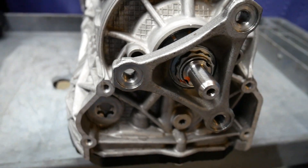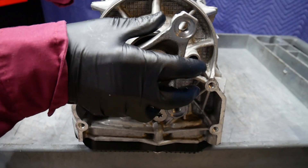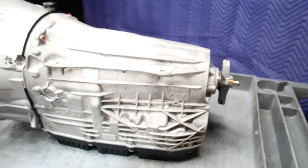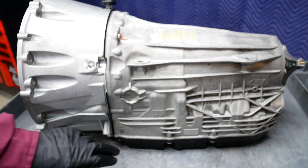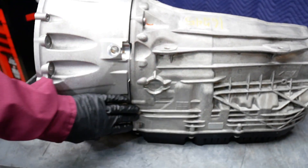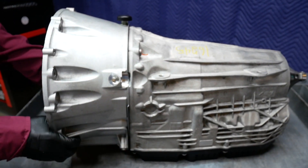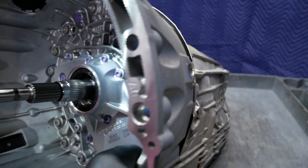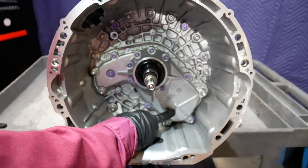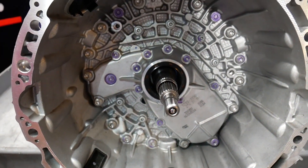In fact, it's actually a little bit lighter and a little bit shorter. Normally, the 7G-Tronic, the 722.9, would have a manual linkage. We have no manual linkage whatsoever. One interesting feature is we have an off-axis chain driven oil pump and an electric pump there in the case.